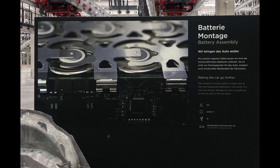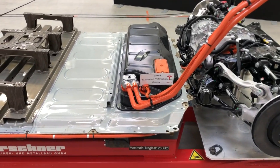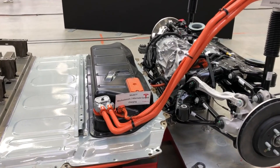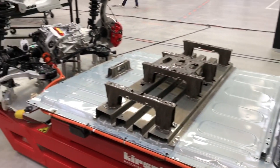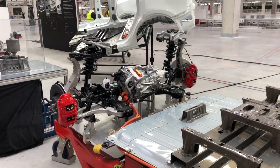Remarkably, there is no fuse wire visible. In older battery designs, fuse wires were connected to each battery to prevent a runaway of one battery affecting the full module or pack. Another display nicely shows the harness from the charge port to the structural battery, and from the structural battery to the rear and forward drive units.